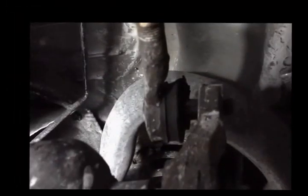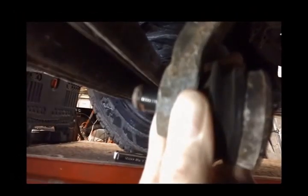Here's what I had to do. I've seen videos on how you do this — I had to take this top one loose. These are basically just outer tie rod ends here, and then I had to take the big bolt that connects it to the axle loose. And I had to pull it out of there — pull this whole thing loose — so that I could get this one to drop down far enough that I could get it loose.